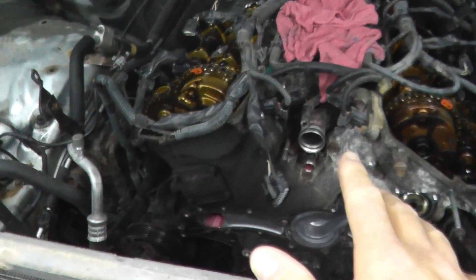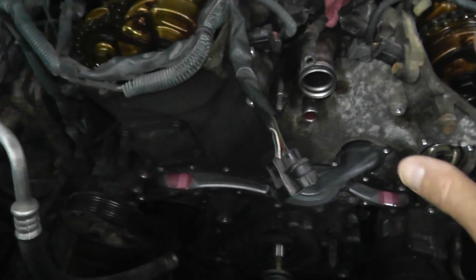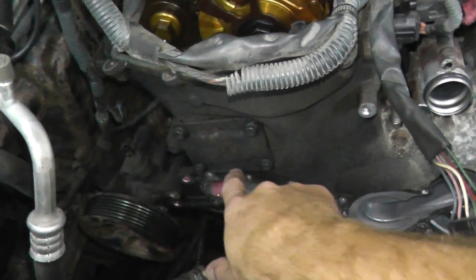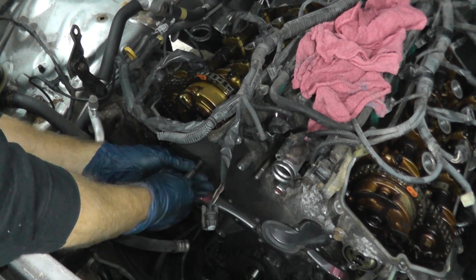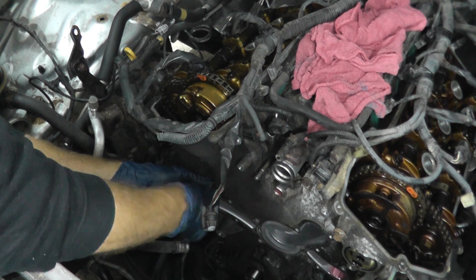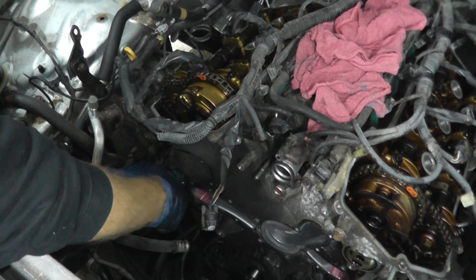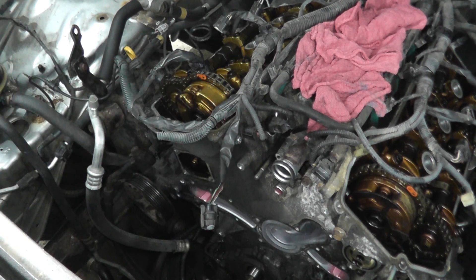Before I do that, this is something you can do with the drive belt installed, the radiator hoses, everything installed. Right here is a little window held on by four 10mm fasteners, on the passenger side. Remove these four fasteners — you can do it with everything still installed, just a little tight — and use your phone to fit into the space.